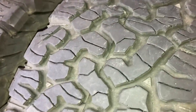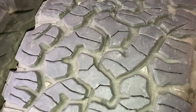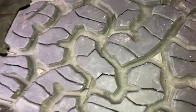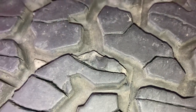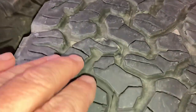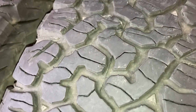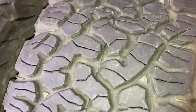Now, firstly, of course it's a compromised tread pattern. This is an off-road grip — you can see the tread pattern, really grippy for dirt, rocks, hills and all that sort of stuff that's going to wrap around and really get some grip. But this one's in good condition, so the flat surfaces are nice and flat and they're going to be able to get some grip on the blacktop as well, because generally it's flat. But once you use them off-road a lot, you get little chunks missing — so that's less rubber there to grip. There are two factors when it comes to water: how much rubber have you actually got there, and you can see here half the tyre's got rubber and half's got gaps. So of course, if you've got a tyre with a lot more rubber and finer, thinner lines — only enough there to get the water out — you're going to get more traction wet or dry on the blacktop. It's always a compromise what tyre you choose.